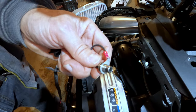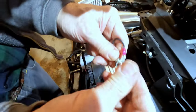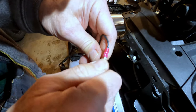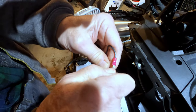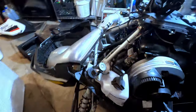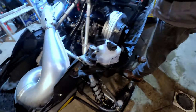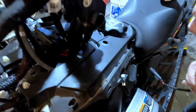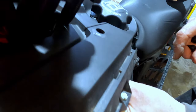There's no nut holding that piece down right there. What we're going to do is install a nut on there to hold that ring terminal on and then reinstall it so we have a better ground connection. Essentially I just had no connection — it was an open circuit. You have to take apart the whole hood assembly to get at this, so it's kind of a pain for this little fix.